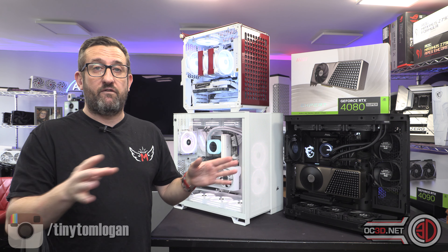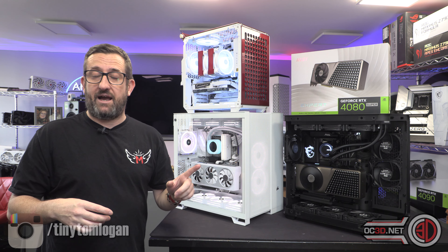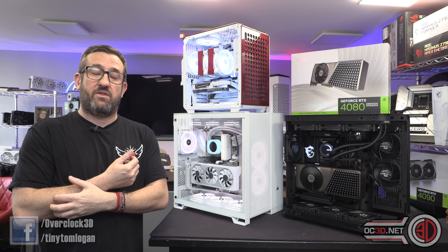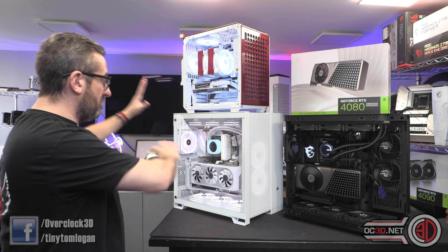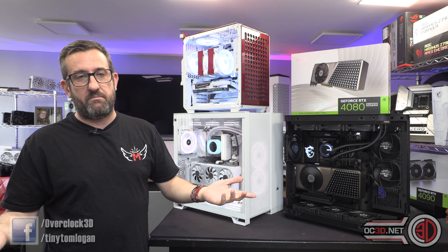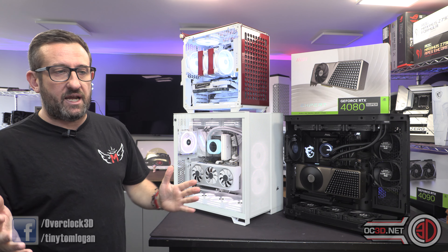All of those programs are free — that's also critical, this is not going to cost you anything but time. Once you've got used to this you should be able to knock out an undervolt in under an hour. You're going to spend longer with benchmarks running than you are going into the BIOS. I'll show you all three BIOS interfaces because they all put things in different places — that's the reason I've done so many, to help you all at home. The load line calibration is also implemented differently across them all.